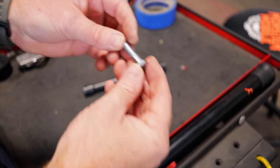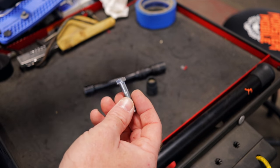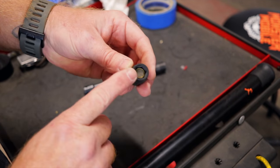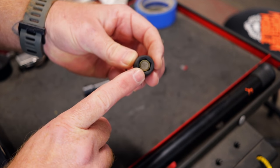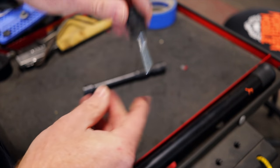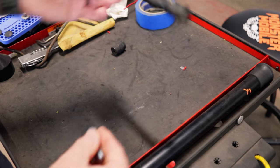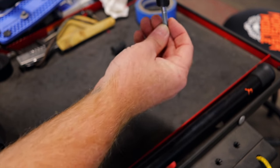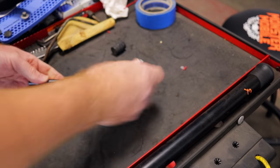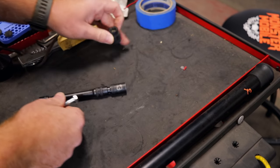My next hack: let's say you've got a bolt you have to put down inside the engine bay, like maybe on the back of the valve cover, and you can't reach it with your finger. They make magnetic sockets or magnetic socket inserts — I know Lange makes them — but not everybody may have them. They hold on to your bolt while you're trying to get it fitted down in there. For example, if you've got it on extension where you have to reach down to get it started, with a regular socket it's just going to fall out and then you're going to have to fish out the bolt.